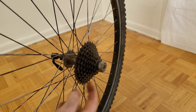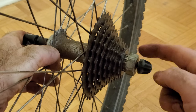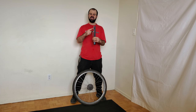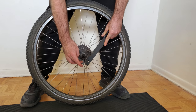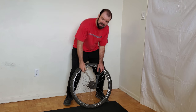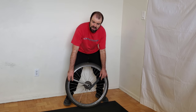The manufacturer recommends that after inserting the lock ring tool, you put the end of the quick release back on loosely to ensure the tool stays fully engaged — but only loosely, as the tool still needs to be able to spin. I place the wheel in front of me with the cassette facing outwards. With the chain whip in my left hand, I place the chain against one of the middle sprockets and wrap the remaining chain around that same sprocket. I then take a one-inch wrench in my other hand and install it onto the lock ring tool, aiming for the chain whip at the two o'clock position and the lock ring tool at approximately the ten o'clock position. I then press down with both hands.